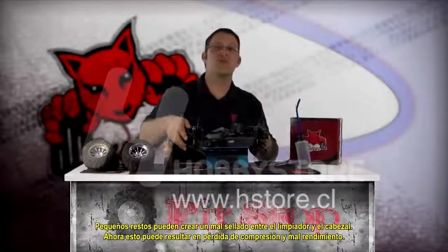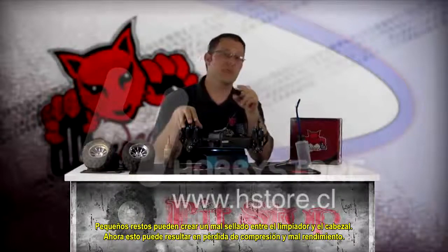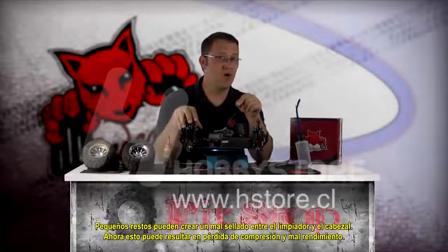Small debris can create a bad seal between the glow washer and the head. Now, this could result in lost compression and bad performance.